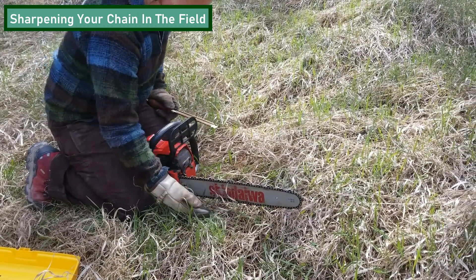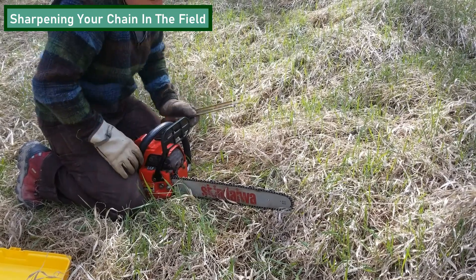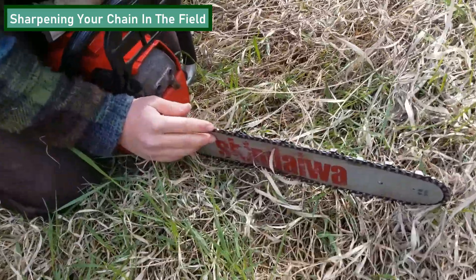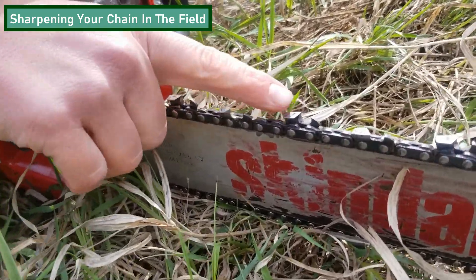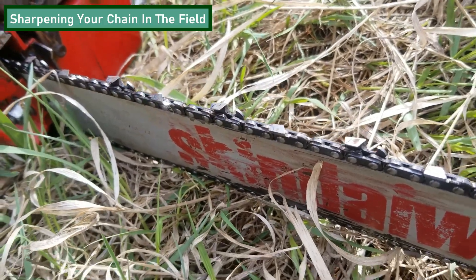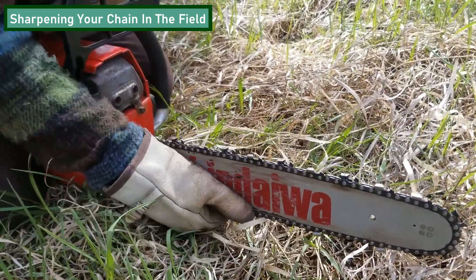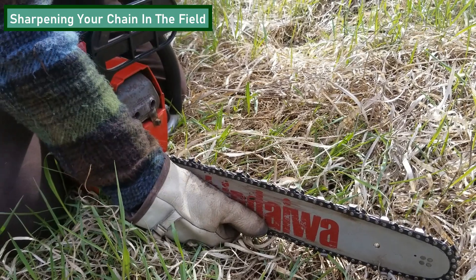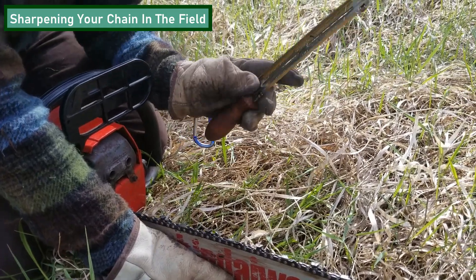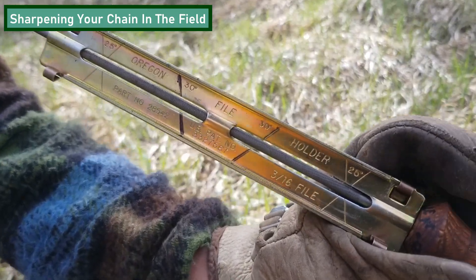Your chain brake is going to be off because you're moving your chain, and then you're going to go tooth by tooth. As you can see on this one, it's nice and sharp here — you have a nice sharp point — whereas on some of these other ones it's a little bit rounded. So to get to that nice sharpness, you're going to grasp the bottom of the bar and hold the chainsaw nice and steady so it doesn't move at all. Your file guide is going to give you a nice 30-degree angle from either side, and that's the angle you're going to sharpen the tooth at.